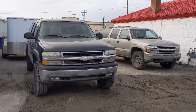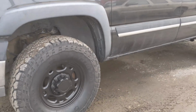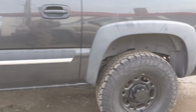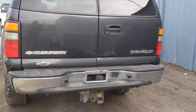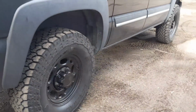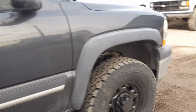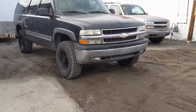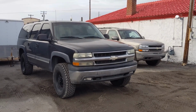So let's go over the three-quarter ton first. I'll do a quick walk around. You'll notice on three-quarter tons you'll have 8 lugs. That's the first indicator. So this is an 8-lug Suburban. This particular one's a barn door, but that doesn't have anything to do with whether it's a three-quarter ton or not. The hitch will be rated for more than the half tons. And obviously it'll have more payload and gross vehicle weight, so you can tow more. They are heavier, and I'll get these details in the description below, but these are definitely heavier.